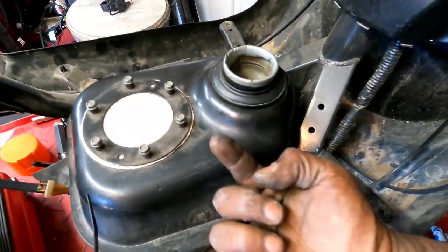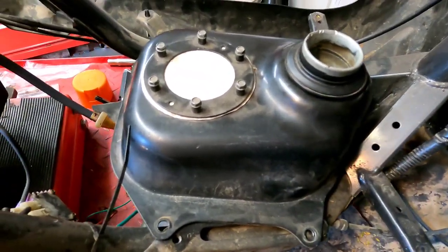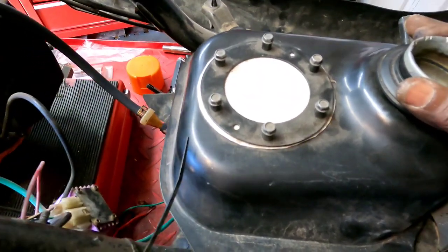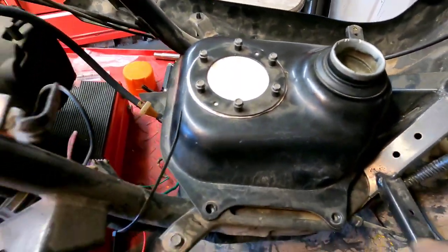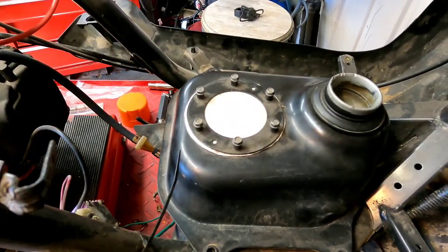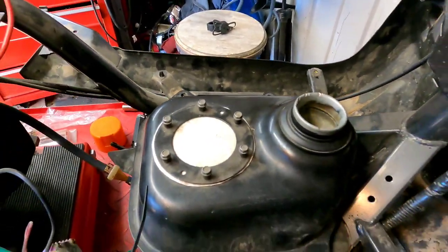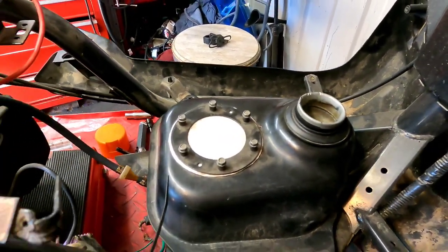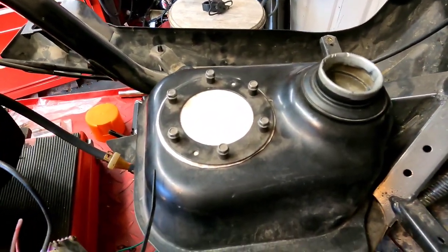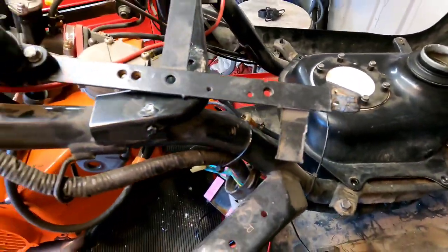Hopefully the fuel line being all the way up against the bottom of that fitting, that nut that tightens it down, may act like a lock washer for me. So, oh well, hopefully it works. But if it leaks again, I think what I'm gonna do is take the washers out and use some red coat. I have some somewhere. It's like a tank sealant, and hopefully that'll take care of it. But it didn't leak because I guess bad design. It leaked because I hit something. Well, I guess that's bad design.